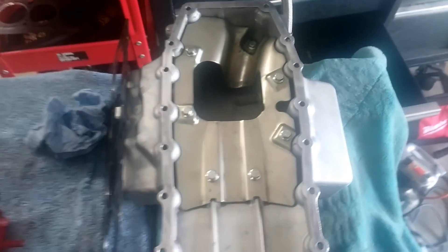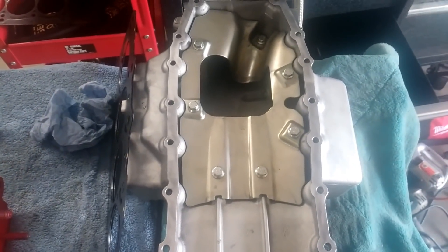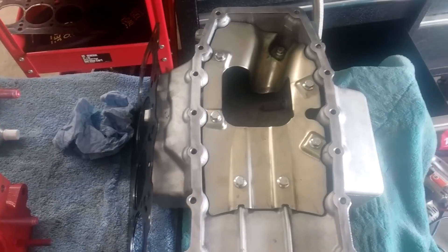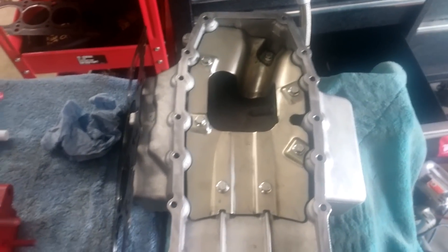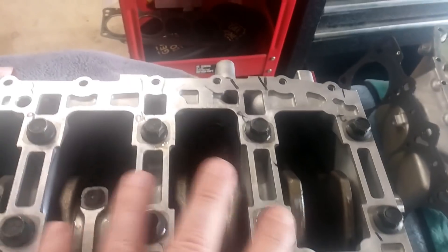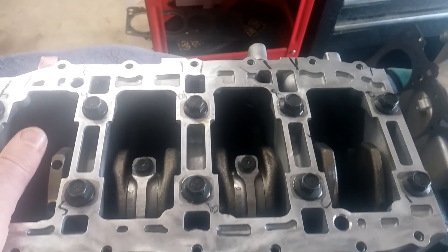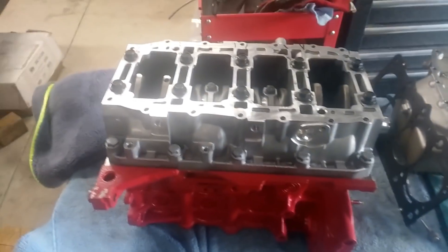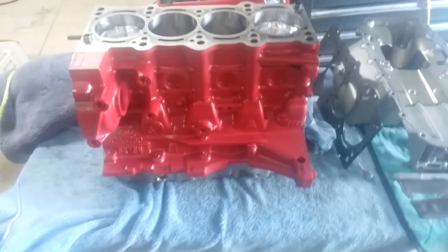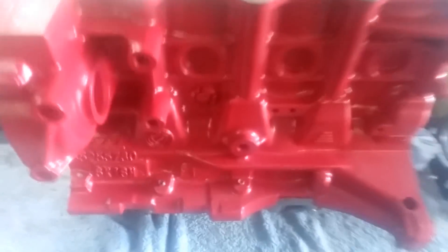Another addition from the previous video: we talked quite a bit about this windage tray. I think windage trays are really great, but that is Fiat 124 only. The Fiat 500 Abarth, including as far as I know the aftermarket oil pans, do not have a windage tray — though that might be different by the time you're watching this. I'm happy to say all the mains and rod bearings plastic gauged out right on spec. I'm extremely happy about that. Let me stop the video while I flip the motor over and show you what's going on on the other side. Okay, so here we are — motor's right side up, as you can see the pistons are in, short block assembled. I'm very happy with how this is going.